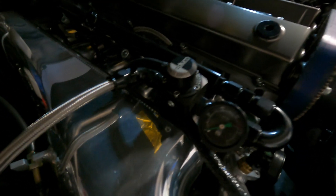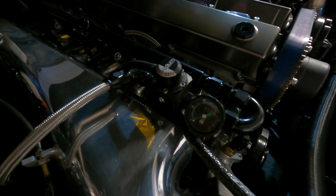After a lot of research we found the fuel pulse damper and decided to give it a try. Now, Neos do come from the factory with a fuel pulse damper — scratch your head, there you go. What these things do is they dampen the harmonics created by the fuel injectors opening and closing. The fuel has harmonic vibrations, and when the injectors open and close at a certain frequency — in my case around 4500-4600 RPM — they actually cancel out the fuel pressure and you see something like no fuel pressure whatsoever. The FPD dampens those and it works fantastic.